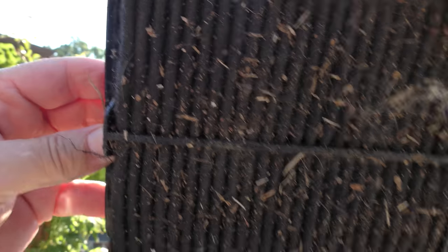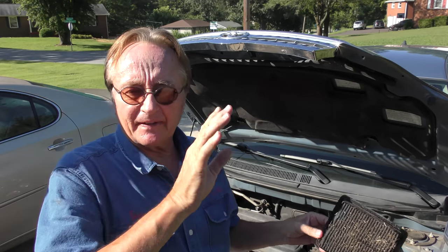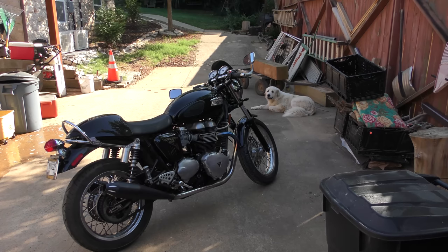You can tell it's horrible because it's all black with dirt, but the best way to check is to put it up to the sun — and it's completely black, you can't even see sunlight through it. For every gallon of gasoline you burn, you use 1,471 cubic feet of air — that's a lot of air. If your air filter's clogged up, you can't suck the air in and it will not run right. Modern cars are computerized so they keep trying to compensate, and for a while the car still runs even as the filter gets this bad. But eventually the check engine light comes on, it runs like crap, and you'll fail an emissions test. So check your air filter every once in a while — it's easy and cheap to do yourself.